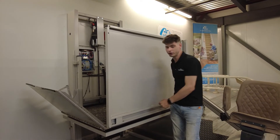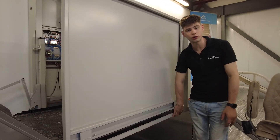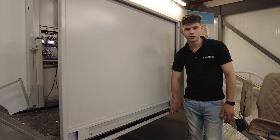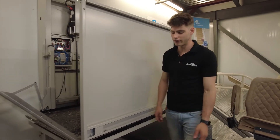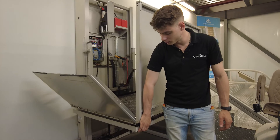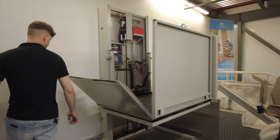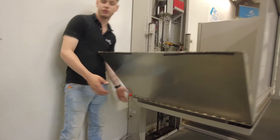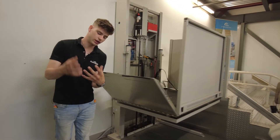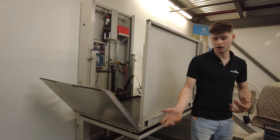So now we're looking at the underpan itself. The first thing to do is to physically and slowly push up on each corner to physically hear the click and unclick of the micro switch on that corner. I grab this corner — you can hear it click — that is good. Do the same for the other corners. If it does not click, then we know that switch is the problem and we need to fix it.